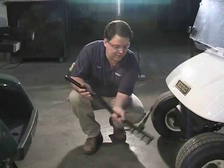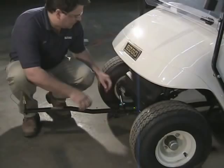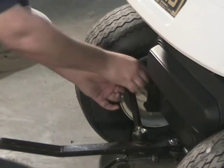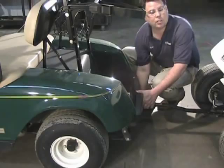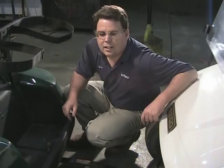First, connect it into the tab on your front axle. Next, take the tie rod assembly and slide that into the spindle. Take your safety clip, run that through the front axle and secure it. Remove the coupling, take your tow vehicle, roll it backwards, and the bar will go up through the center hole in the bag well assembly. Once you have your tow bar up through there, simply take this piece back, fix it to the tow bar, and your tow bar is now locked in position. You're free to tow the cart at up to 10 miles per hour back to your location.